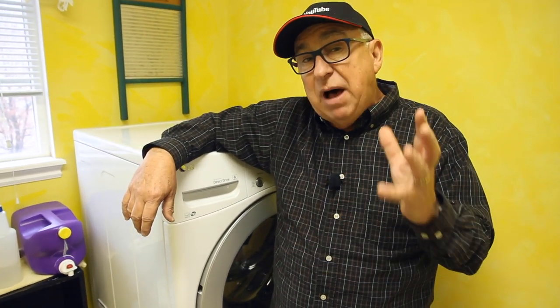It's our pleasure to pass on some of those great insights. Number one, the biggest complaint people have about these machines is that they could stink sometimes. One of the strongest pieces of feedback we got, heard many times over, was that one of the biggest things you can do is to switch away from liquid detergents and pods, and use dry detergent to begin with. That greatly reduces the amount of biologicals that remain and become the breeding ground for mildew and so forth.